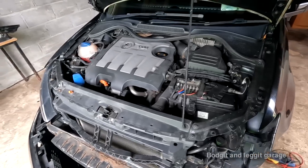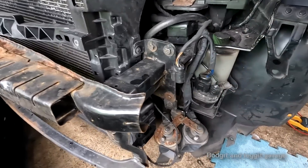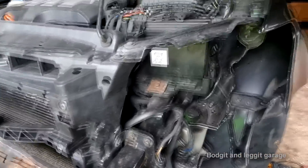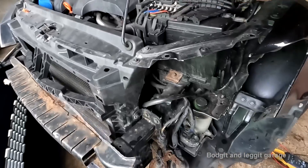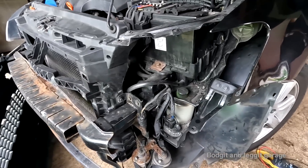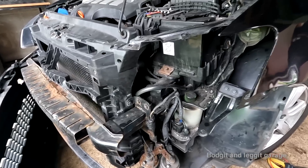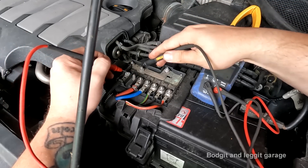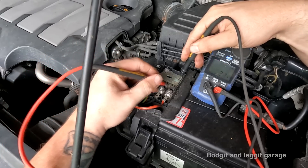What we need to do is check a few things. You can see we've got the fuses at the top, so I'm going to check the main wires first. Do a quick visual check — I can't see anything wrong, nothing rubbing, nothing that looks bad. But that doesn't mean anything really. I'm going to do this with no wiring diagrams. With something like this it's fairly simple. Even if you're unsure which fuse it is, use your multimeter: put one end on here, one end on a fuse, and you'll find out which wire goes where.